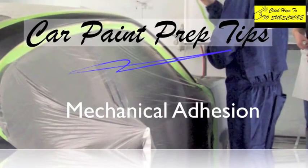Mechanical adhesion. This just expands on sanding a car to provide that tooth for it. It's a mechanical adhesion. If the paint was not sanded and it's just that real glossy, smooth finish, it'd peel off because there's no mechanical adhesion. If you can imagine painting a piece of glass, it's so smooth it wouldn't stick. It'd just peel off.